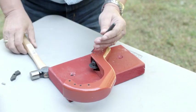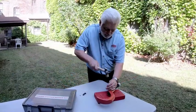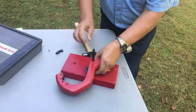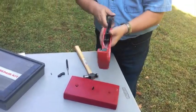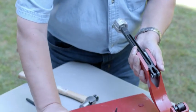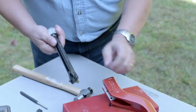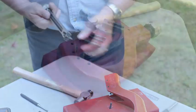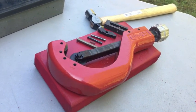Pin number one, pin number two. Now what we're going to do is remove the block — this block is the piece that keeps everything in place. Then we're going to take out the slide mechanism. The slide mechanism has a spring attached to it, and when you put this back in we will reattach the spring and the tool will be as good as new.